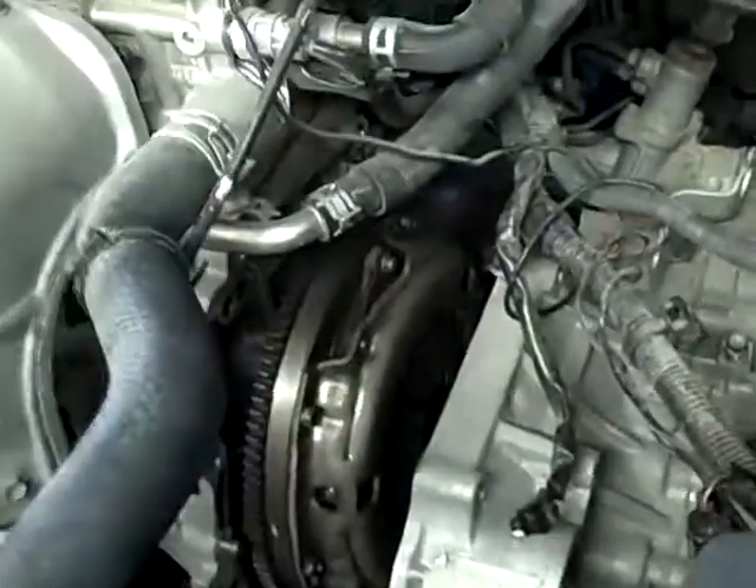The transmission's not out — how do you change a clutch? Well, there's the input shaft right there. You can see the clutch fork. I've got access enough to where I can get the throwout bearing on and off, get it done. I have access to all of the clutch components by way of the bolts to get the pressure plate off. I can reach my whole hand, arm, wrist, everything up in there. Here's the bolts that you need to take the pressure plate off. I can line all that up and reach in there to get a clutch pilot tool in.